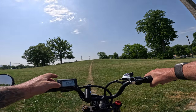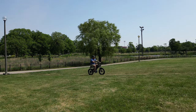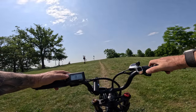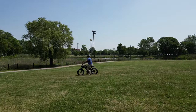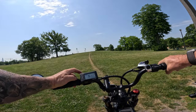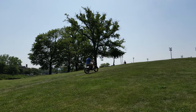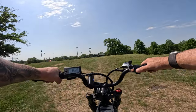I'm curious — let's try pedal assist level one on the hill. Pedal assist level one is not going to get us up the hill; I'm assuming it's only giving us about 250 watts — actually it was giving us 389 watts at the time. We'll swing back around and try it with pedal assist level two. We know it'll do it on three, we know it won't do it on one. On pedal assist level two, it's giving us every bit of the 750 watts of power heading up — just close to it. We are making it up the hill, a little bit slow, but we're making it.